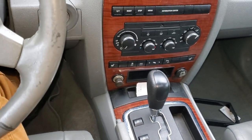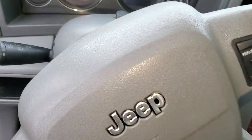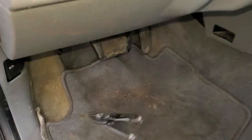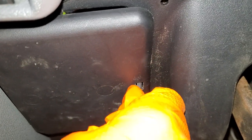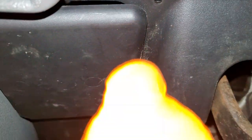We're going to start by checking the three fuses that are inside of the car, and you'll need some needle nose pliers like this to really get at them. We're going to pop down here. Now this car has two outlets in the front and one outlet in the back. To open the fuse box you push on this little tab to the side and that will allow the door to pop down.